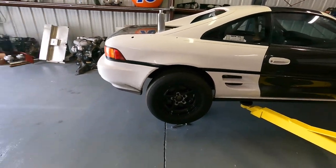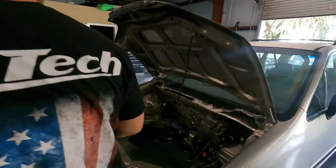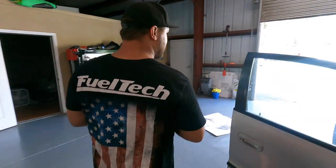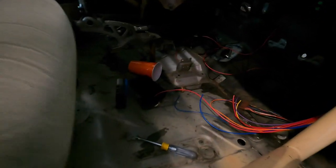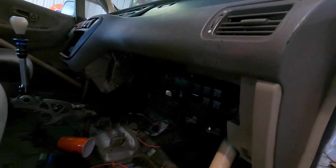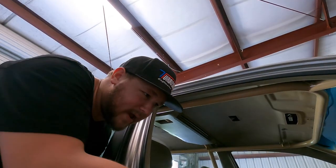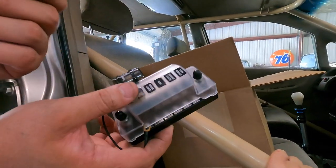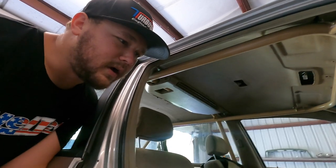Got the oil draining on the MR2. While I've been working on the Miata, Wyatt has been wiring away on the S14. We finally got the fuse box in along with our relays, all set up under the dash with a little mount. We've got a nice big power and ground lug so any accessories we add can go right off of those, a little fuse box, and a flasher relay for all the lights. Everything in the relay box is run — now it just needs to be terminated and integrated into all the extra little harnesses. It's getting pretty close.